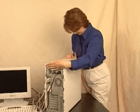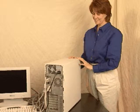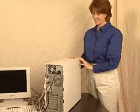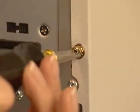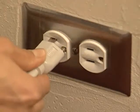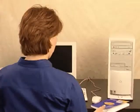Now that your CDWriter Plus has been installed, it's time to reassemble your computer. Start by putting the cover back on, making sure that all cables are tucked inside and don't get caught on the cover. Secure the cover by replacing the screws you removed earlier. Plug in the power cord or the power strip. Turn on your computer — it should start up as it normally does. Then, software installation will automatically resume.